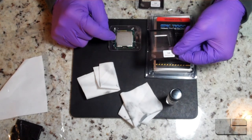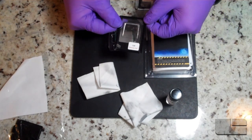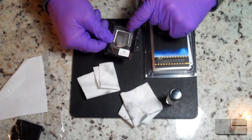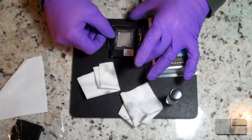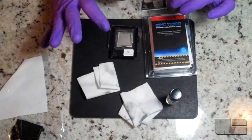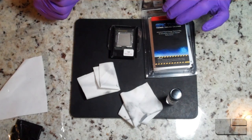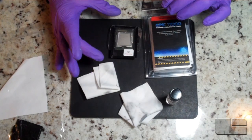When you place this into the motherboard and clamp it down, you take one of these sheets and peel the two liners off. You start by peeling the bottom liner off. You can see the little black alignment square — you line it up on top of the chip, then peel the top off. This black piece is very thin and stays there as a permanent part until you want to remove it, but then you ruin the TIM since it's a single-use product.